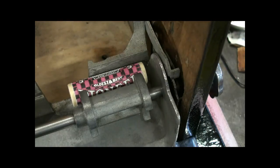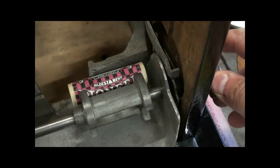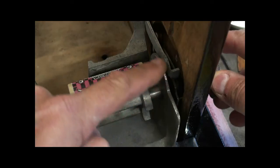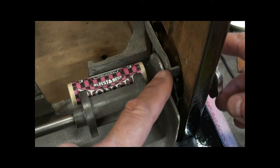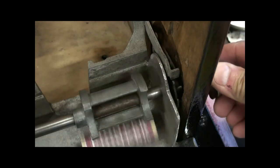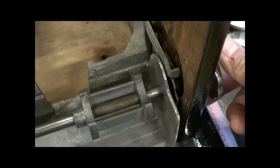Here's a closer shot. Once I'm ready to vend these mints and this handle gets raised up, you'll see the other lever come through and hold it up in the air. That one went forward and now that keeps this off of this wheel so I can turn it and vend the mints, then drop back down into position to hold it from going any further.